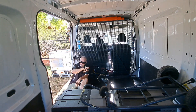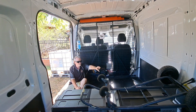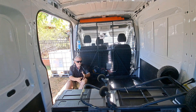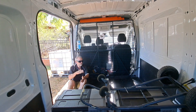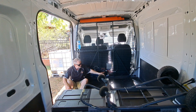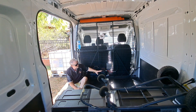We've got two fridges running — 2x52 litre fridges. You can run them both as fridges or freezers, one fridge one freezer, whatever you like. I've got the cable running through on both sides, 58 running over there to an Anderson and 58 running through to another Anderson here. I've cut the plugs off the fridges — these are Nomad Arctic fridges, N52s. We put Andersons on them because the connection is much better and more secure so when they're bouncing around it's not going to disconnect. The two fridges are running off the battery and it's connected to the crank battery with a 40 amp fuse. I'm going to change that to a 40 amp resettable or circuit breaker.